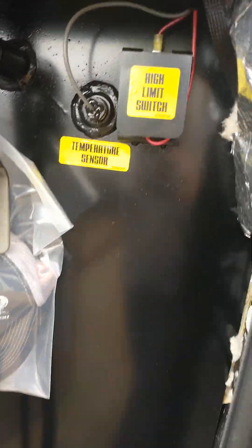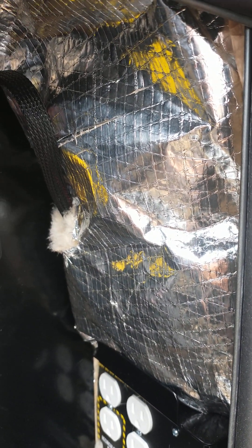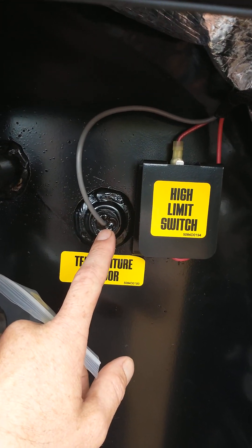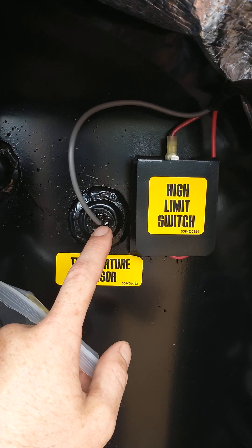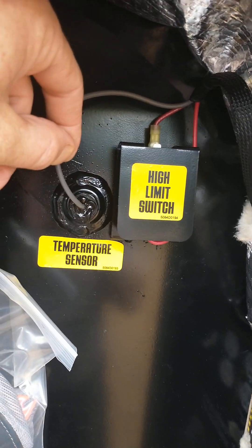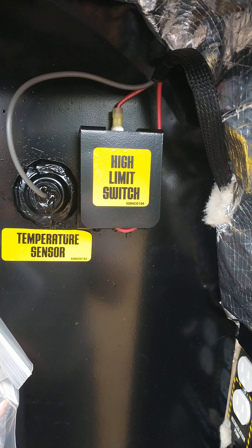Here on the back side, it's behind this insulation. I'm going to show you the actual controller inside in the shop so you can see what it actually is. But what I want to show you back here is where the temperature probe goes into the tank. It's a brass fitting and the probe is inserted into a hollow space in the fitting, held in with black silicone. If you ever replace this controller, you just pull on the probe and it'll pop out of the silicone — you don't have to thread the fitting out of the tank or drain the tank.